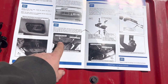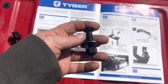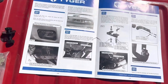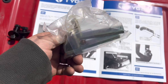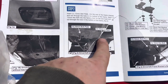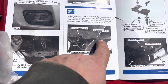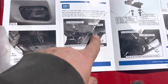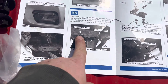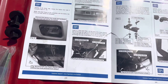We're going to find the 12-millimeter bolt plate and the 12-millimeter hex bolt — there are only two in the package, so it's just the two biggest bolts and the two biggest nuts with the washers. The plates are in a separate bag so they're easy to find. Take this bolt and push it into where the factory bolt hole is, and then there's a slot right directly behind that hole — slide the plate in there.